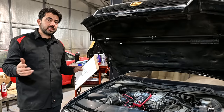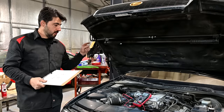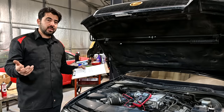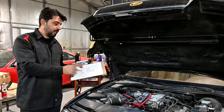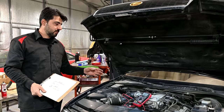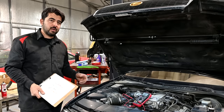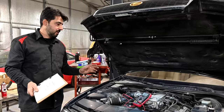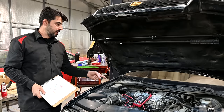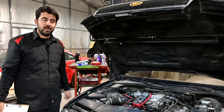Now doing more research, a lot of people are saying that it's the car's computer that goes bad on these cars and can throw code 41 for the throttle position sensor, and the problem they're having is they're not getting 12 volts for the idle switch. We're getting 10.5 volts — that's just close enough to battery voltage, partly because the battery is kind of drained on this car. But that switch should not be working like that — it should just be on and off. That's why I feel comfortable making the call on the throttle position sensor. Going to go to the store, pick one up.